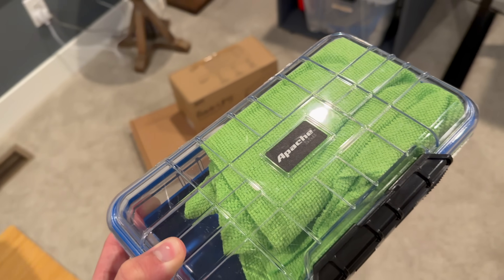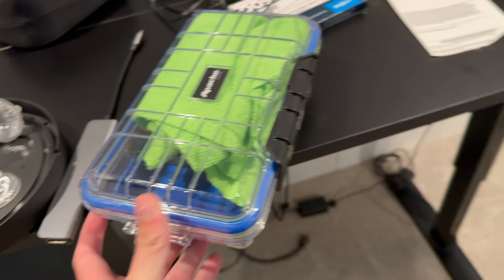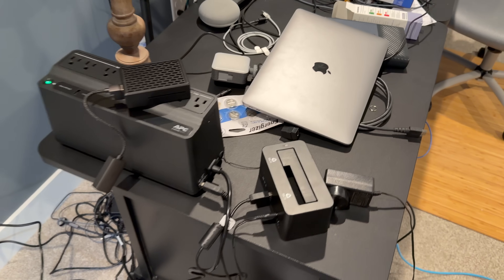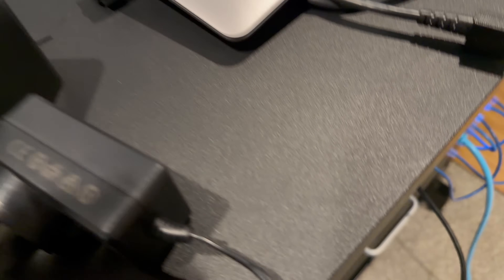From the previous video, I brought an eight terabyte drive over, but unfortunately it failed and was no longer passing any SMART tests — so we're moving on from that drive. That being said, I've got the UNAS right here as well as the POE injector that it came with. I'm going to do a small test setup of everything right now to make sure it all works before I bring it over there, so that tomorrow's trip is just a quick set-it-and-forget-it kind of deal.